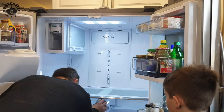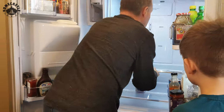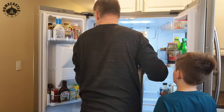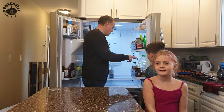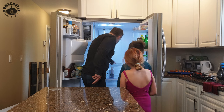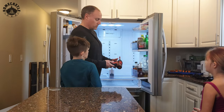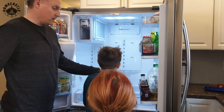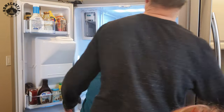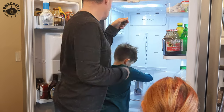There's a little tab you need to press down right here — press it and wiggle this forward and it'll come out. The tab is just a locking piece. There's no support on this panel so don't rest your arms on it. Remove the screws — there's one underneath — and there's also one at the top, but first you have to remove this little decorative cover.